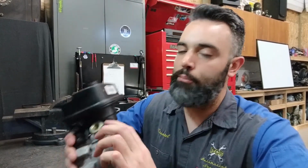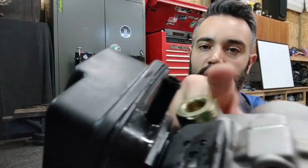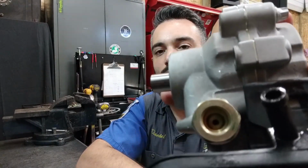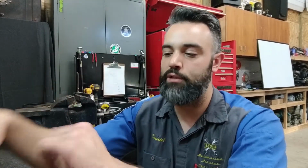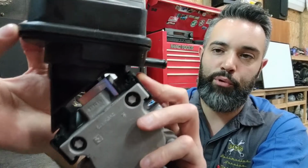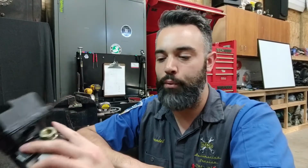So our outlet from the pump is going to be a threaded fitting that accepts a rigid line or hose assembly that can hold the pressure. Once that pressurized fluid gets to the restriction or goes through the circuit, through the flow control or the pressure relief valves, its pressure will then be released by the time it gets back to the return circuit and goes into the reservoir. If there was to be pressure put onto this reservoir, this seam would break, the hose on this end would not be able to hold, and the system would not be working.